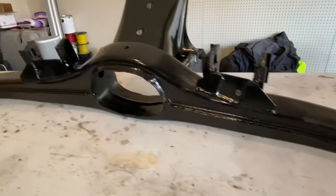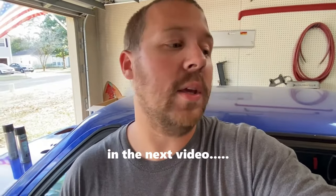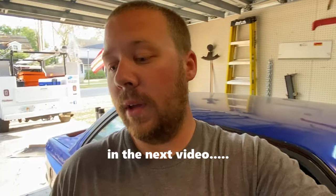The subframe is all painted and back together — it doesn't look too bad. I did just a rough scuff to prep it. I'm really not searching for perfection here; I just wanted to get a couple coats on it to make sure it wouldn't rust. So we got it all one color, and we're going to pull the subframe that's in the E30, get the trailing arms removed, get those reinforced, and get those onto this subframe and get it all back in the car.